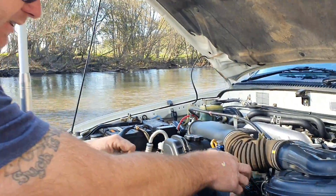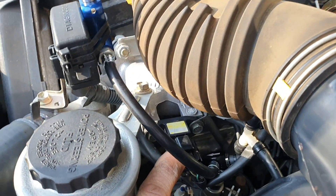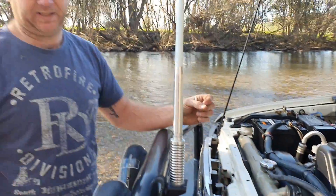So I heard about this thing called a fuel cut defender. You've got a fuel cut defender one which is like a vacuum one, and then you've got a FCD2 which is an electronic clamp — it piggybacks into your boost pressure sensor. What I've done is piggybacked into the boost pressure sensor here. So I've tricked the boost pressure sensor into thinking it's getting say 10 psi, when in fact now the ute makes 18 pounds.